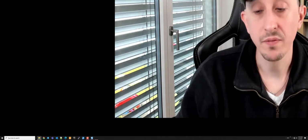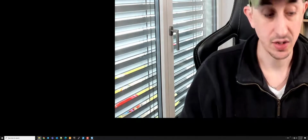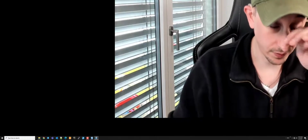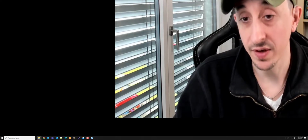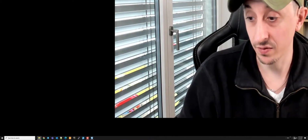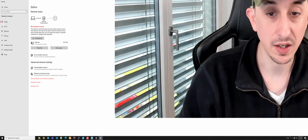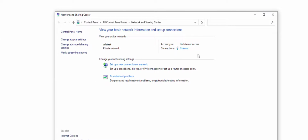If you are unfamiliar with what the default IP address is, you can download a tool. It'll do a search and it'll find it for you. Not every router will have that opportunity, and there are better ways to do this. The next thing to do here is to check your connection. So for example here, when you plug a cable in, you will get this little guy pop up here, and if you go into details and look for the gateway, you'll see 192.168.1.1.